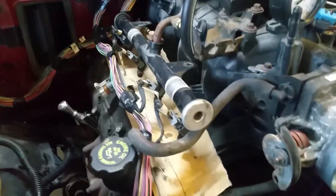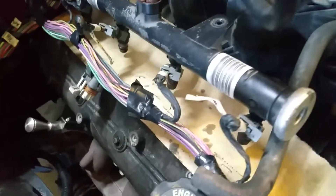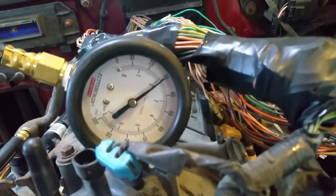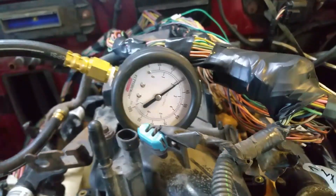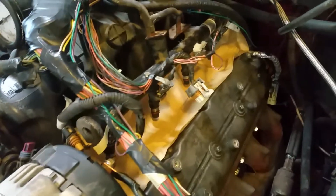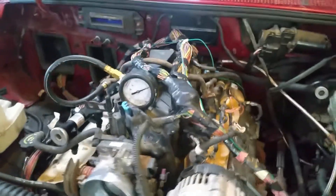Just a quick update to this supposed leak situation. I've had this out for quite a while now and I haven't seen one drop. I pulled the valve cover off and I had oil on my hands — that's what those drops were — but there isn't anything coming out of the injectors on either side, so they look pretty good. It's dropped down to about 30 PSI from 60-65, so I'm thinking it's just the check valve in the tank draining back into the tank, which I'm fine with. As long as it's not leaking into the cylinders, I'm fine with it.